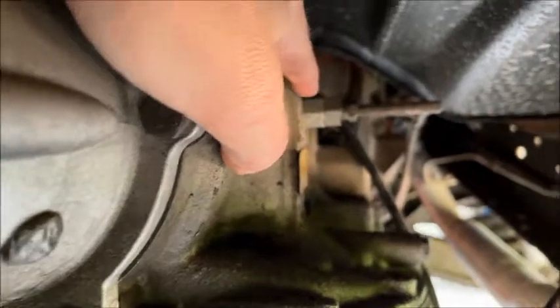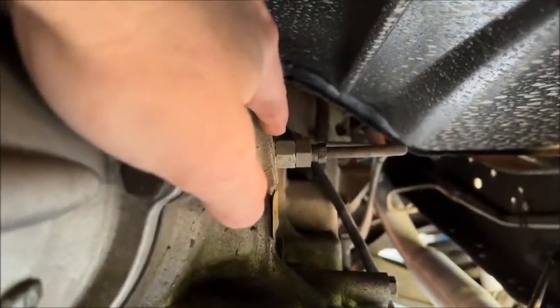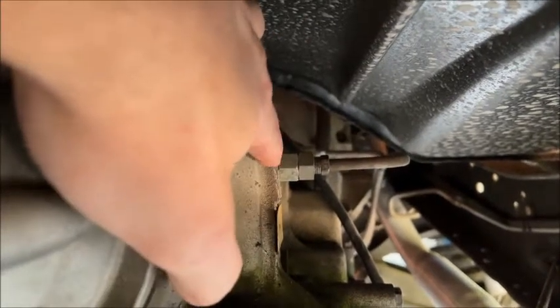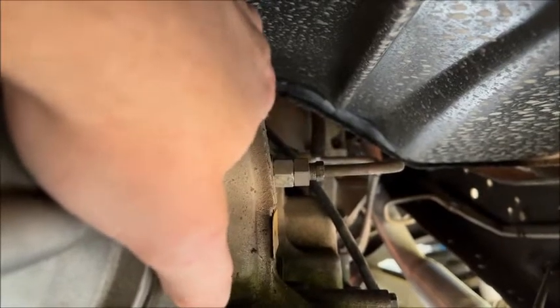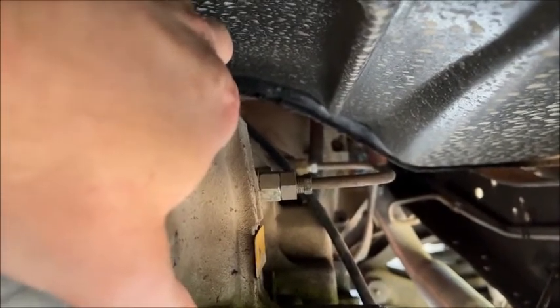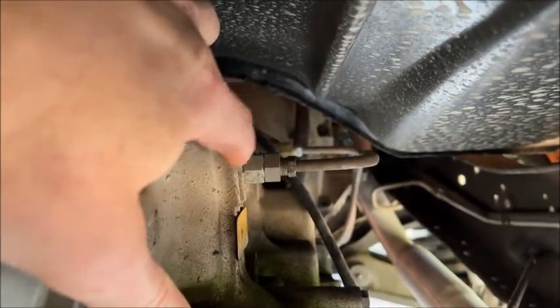It's a little tricky finding the one in the back. That's the long one — be sure you use it because there's a short one and a long one, and you need that long length to properly oil the rear planetary. This fitting, depending on where you get it, can be poorly made. The first one I got snapped off. The second one had Teflon tape — just throw that in the trash, put an o-ring on there, and you won't have any problems with leaking.